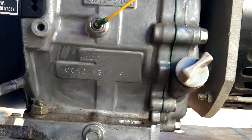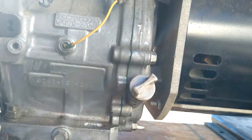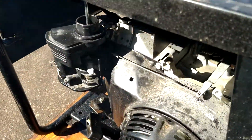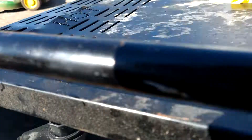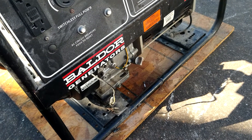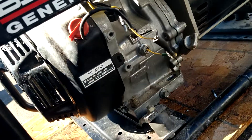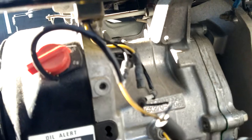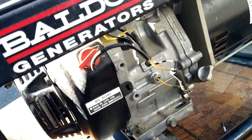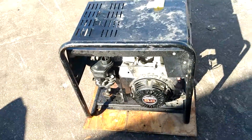The coil wire is still good — we might have a bad switch. The smoke stopped and there's just some burn-off on the muffler but it's not smoking anymore. This engine actually sounds amazingly well considering it was frozen up just three hours ago. It turns out it was just a bad tip-over switch sensor — I hooked it up without it, so we're going to leave out the tip-over sensor since they're not going to be tipping this thing over anyway. All that's left now is the air filter and cover, and she's ready to go.